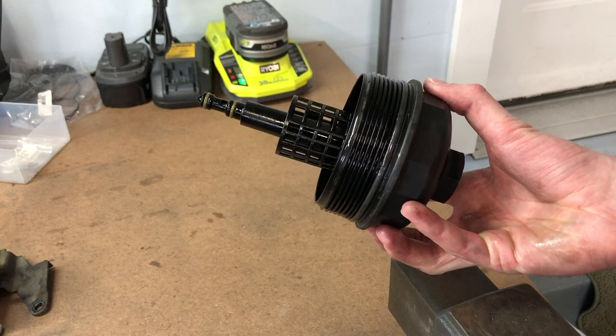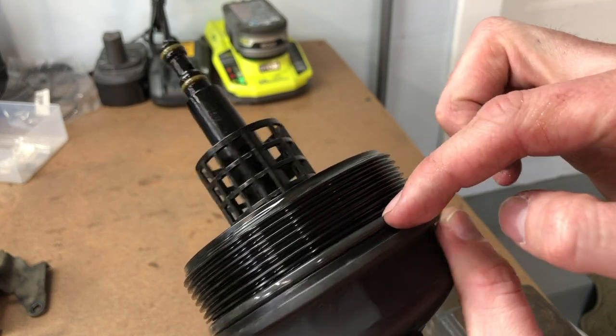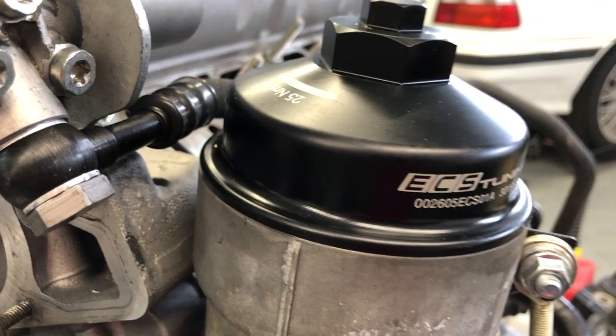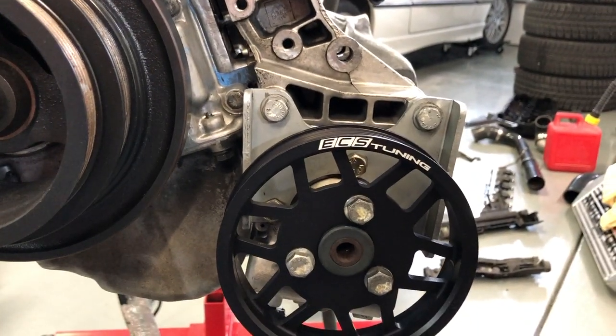At this point you're basically done. Just remember to move your O-ring gasket from your old cap to your new cap, or use a new gasket if you're replacing the filter. There you have it — a quick, easy way to improve the look and durability of your oil filter housing cap. Other ECS Tuning parts shown on the front of this engine will also be linked in the description below.